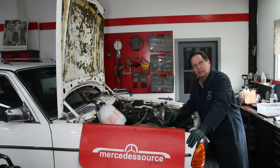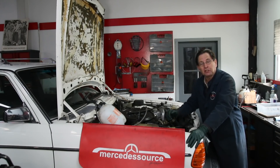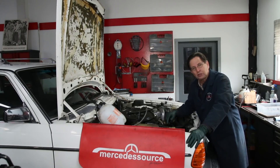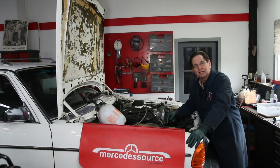Most people call it a radiator pressure test, but it doesn't have to be just for the radiator. I'm going to call it a coolant system health test. That means you pressurize the system and look everywhere — you will see where the coolant is coming out.